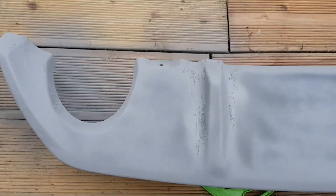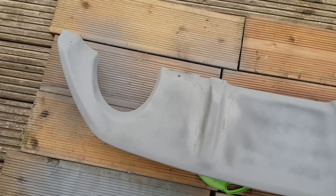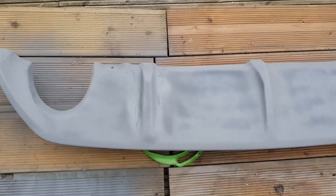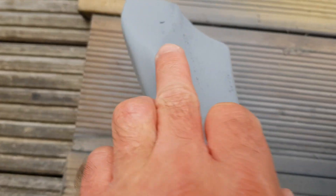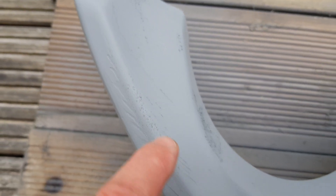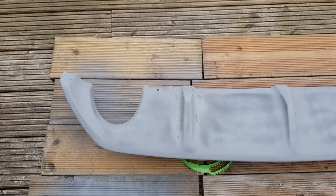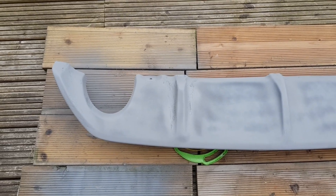We've hit it with a couple of coats and we're still having trouble with this area here. What I'm going to do is hit it with another coat or two, then wet sand to see if we can take this flaking out. This is where it's come down to the original plastic so it's a little bit bubbly. We're going to wet sand this to see if we can get it smooth before moving on, giving it final coats of primer and a final wet sand, then hopefully prepped for glossing. Starting to hit it with a little bit of wet and dry sandpaper - as you can see it's already smoothed out. There was cracking here along here - that's smoothed out.